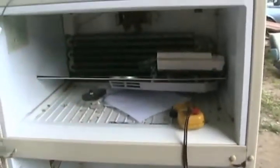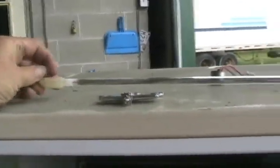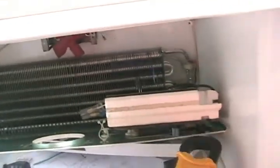So the fridge may end up running all the time just trying to keep itself cool and make the freezer extremely cold, but no cold air is getting down there. That's because your heating element isn't turning on — and that might not be turning on because it's burned out. It's easy to check with an ohmmeter when you take the cover off the back, so long as there isn't so much ice there you can't get access to it.